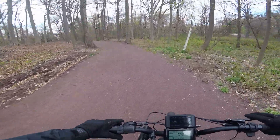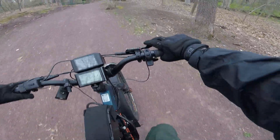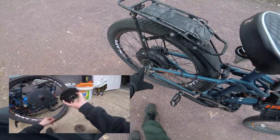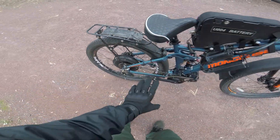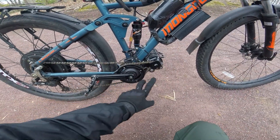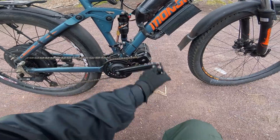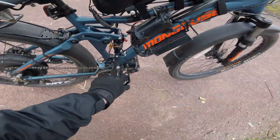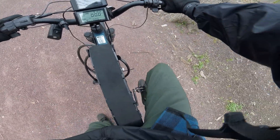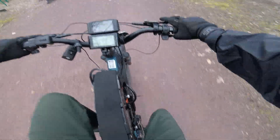If it's popular demand — I still have that noise by the way, I'm sure you guys can hear it. The issue with my freewheel is completely fixed, no issues there anymore. But every time I do a rotation of the arms in the same spot there's like a thud. I completely disassembled the bottom bracket and when I spin the pedals backwards there's no issue at all, it's buttery smooth. Only when I go in this direction there's like a thud and I can feel it in the pedals. I have no idea what it is, I didn't over-tighten any of the bolts, and at this point it's just frustrating me.